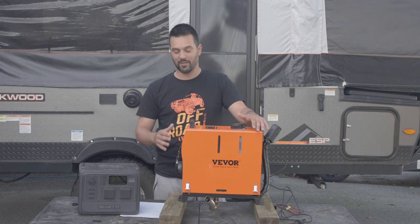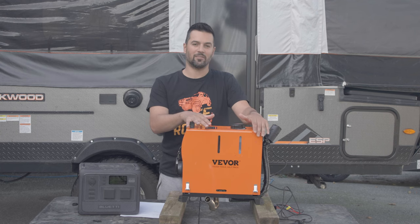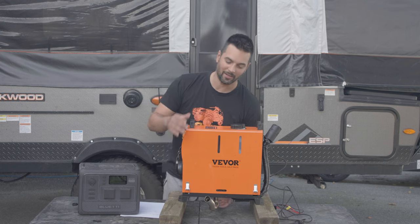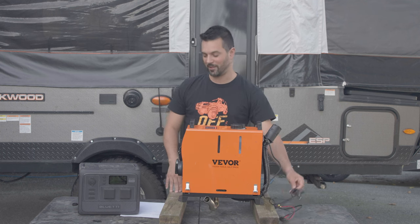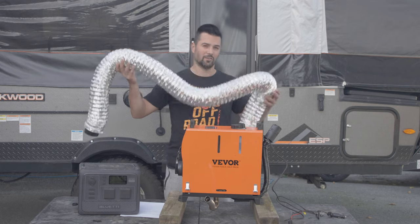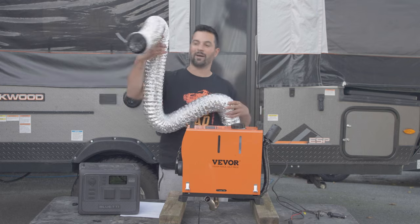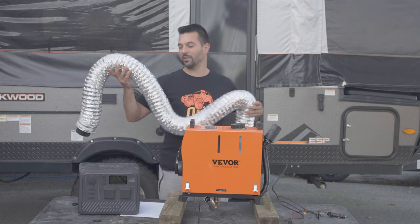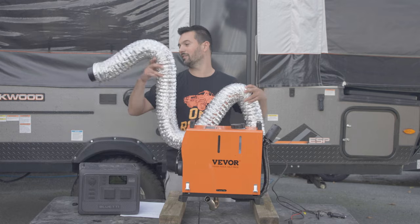Overall, I've had no problems with it. If you decide to get one, the link is in the description — this is the all-in-one version. You will need to get a couple of 2x4s to lift it high enough that the exhaust won't burn whatever it's sitting on, and some sort of plug. You'll most likely also need a dryer hose; I couldn't find a 3-inch one locally so I got a 4-inch one and had to buy adapters. You can find 3-inch ones online on Amazon. The one it comes with is only about 2 feet long, so you'll most likely have to buy a longer one.